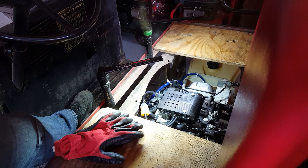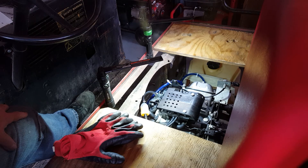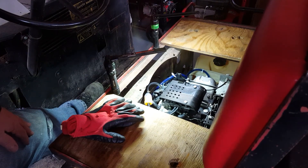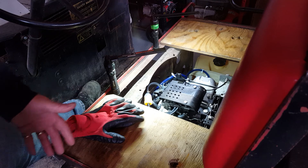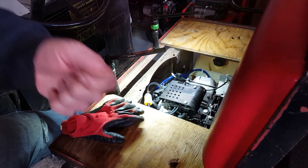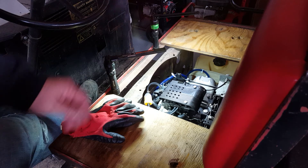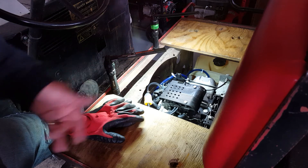I think part of the reason is that — this is three-and-a-half, nearly four years now — when the Cushman originally had a tank down here, it was all rusted and in terrible shape. I cleaned it all out — rocks, three or four hours backwards and forwards cleaning. But there may still have been a fair amount of junk in it. And when I transitioned over to that tank — not the red one you guys have seen, but an old black tank I've never filmed — I think it forced a bunch of junk into the original diaphragm pump that came with the Predator, and that may have been part of the issue. I tested the fuel pump that I had on here — turns out definitely 2.5 to 4 PSI, way more pressure. When you pull the top pipe off going to the carburetor, that's three, maybe four times the physical volume obviously, pressure higher.